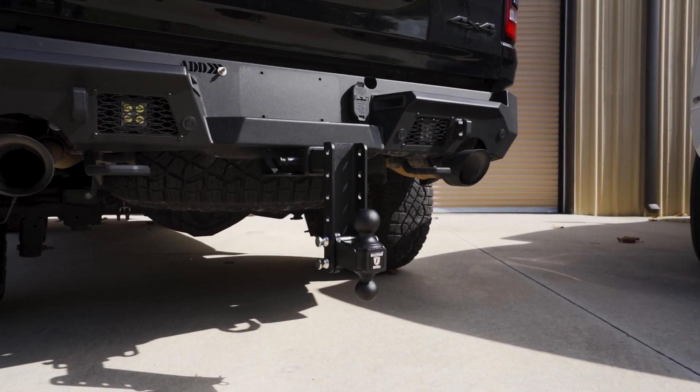You should also consider how much your vehicle will squat when towing. If your truck squats more than 4 inches while towing compared to its unloaded height, it is best advised to pick the next shorter drop hitch. For example, this TRX squats 5 inches when the tractor drives onto the trailer. Since the truck's rear sinks more than 4 inches, it is recommended to have the next shorter drop hitch. This will eliminate the threat of running your hitch aground.